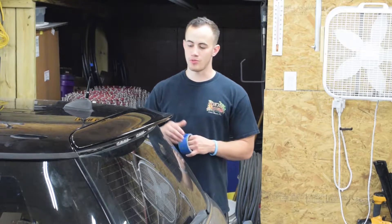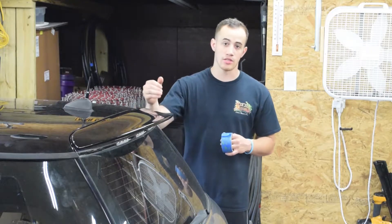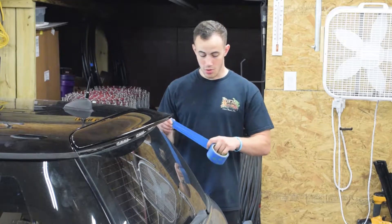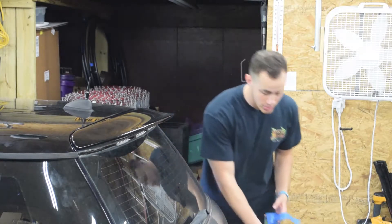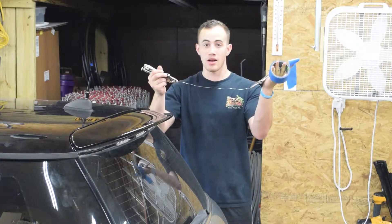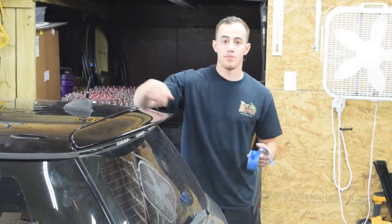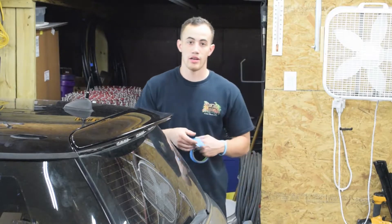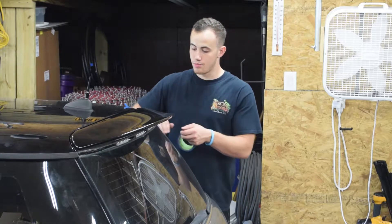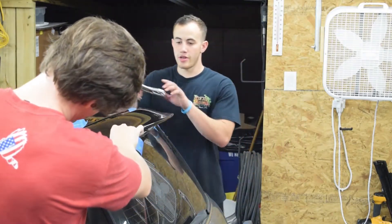After some more research: on top of the two nuts and bolts connected to the stock spoiler, there's adhesive that needs special work. We're going to tape around it because we're going to use two vise grips and some really strong steel wire — or you can use fishing wire — and literally just pry in between the spoiler to break it apart. We'll tape it off and then move to step two: taking the stock spoiler off.